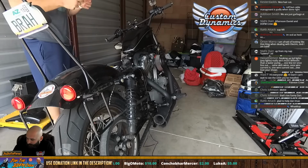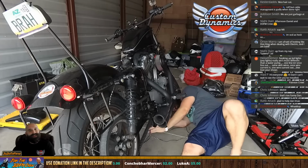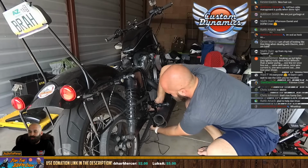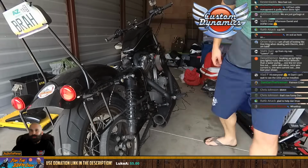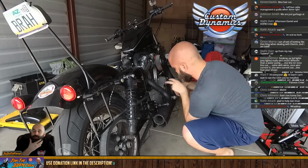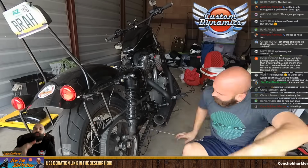I get a call from Jacob, and he's like, hey man, how you doing? I'm like, well, not so good. I can't figure this out. And so he's like, okay, let's troubleshoot this. He's like, push these buttons, does this button work? I'm like, no. Okay, do you have any LEDs come on? No. He's like, okay, so pull out some of the black wires. And he's going through this situation with me. He's like, okay, now ground it on something else, ground it on part of the frame, a bolt that isn't painted.